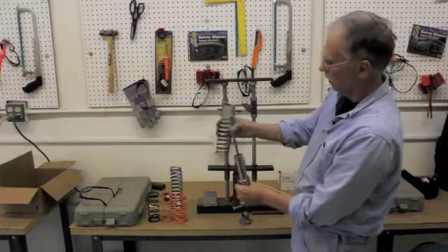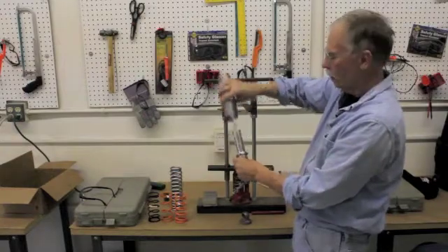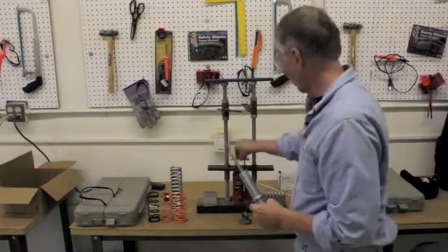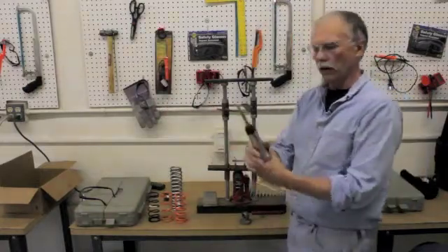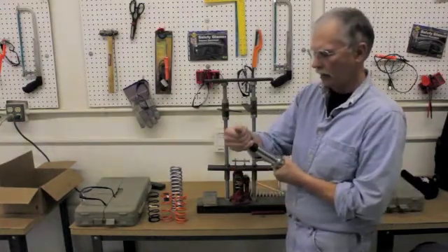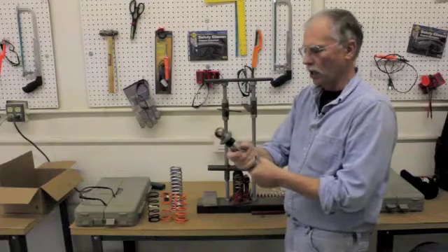Remember I said to look at the opening — this is the top, this is the bottom. The bottom sits on that washer and is retained nicely. If we reverse it, notice how it doesn't fit. Proprietary. Now here's the jam nut, and this little conical rubber piece is called a bump stop. When the shock absorber reaches maximum stroke, it doesn't hit metal-to-metal and slam the internal parts together — that's very bad. The bump stop provides a soft, gradual impact so the shock is not damaged.